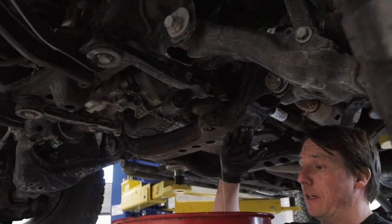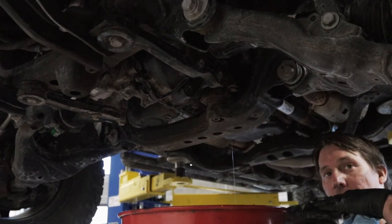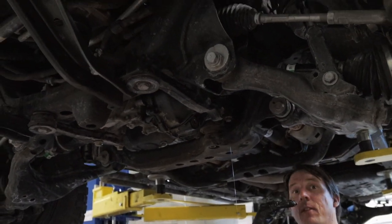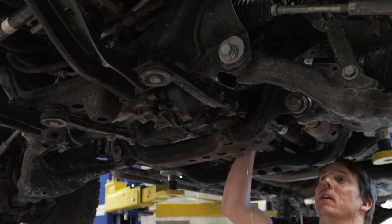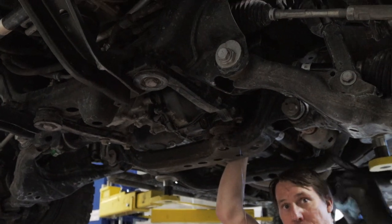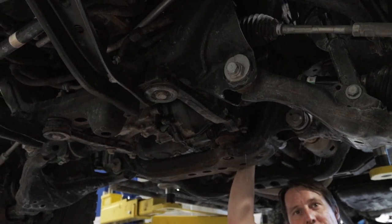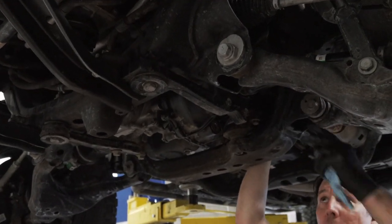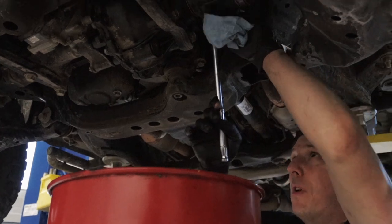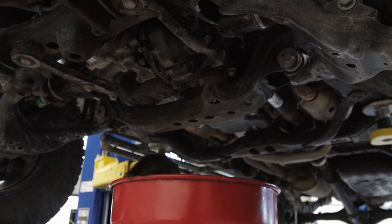The fill mark on the differential fill plug is between zero and negative five millimeters from the bottom of the fill plug — so the fill level is either perfectly level with the bottom of the fill plug or up to five millimeters below it. Anything above the fill plug is not acceptable. When some people do diff fluid changes they pump until fluid comes out, then cap it off — that's technically overfilled. These are just crush washers, so just double-check they're tight; no need to over-torque them.